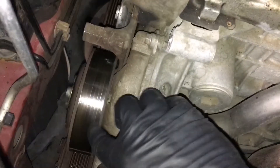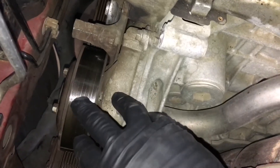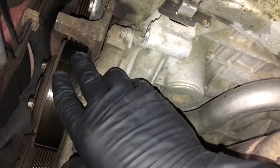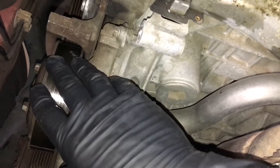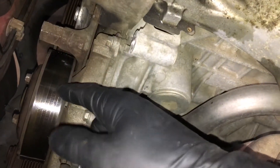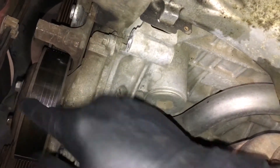This is what made me stop and record because I know some people do have trouble with this — you do have to pull off your water pump pulley as well, which is right here. Here's your water pump pulley. Obviously if your belt is on and your tensioner is not too bad — though more than likely it is too bad — you can use the tension from your belt to bust these 10-millimeter water pump bolts loose. More often than not you're going to be unlucky and your belt will slip and you won't be able to break them loose.